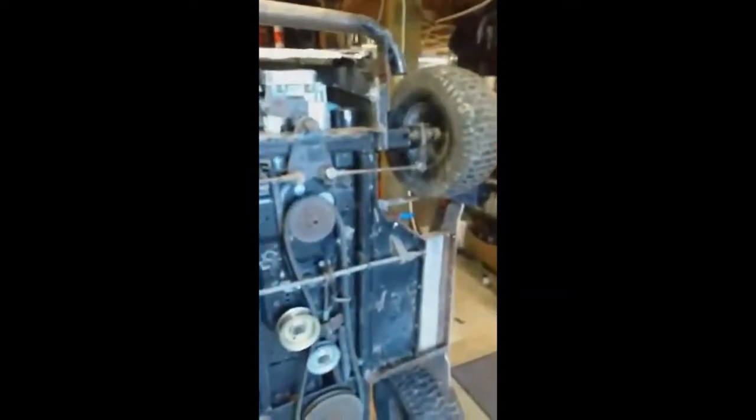We'll now go across to the other side and see what this side says. Again, straight up and down with the level across the center of the axle, then get the sight glass level and place the phone on here. And we've got 1.2 degrees. So 1.2 degrees of toe-in is too much for me - I want to get it a bit less, so I need to move the wheels to reduce the toe-in.